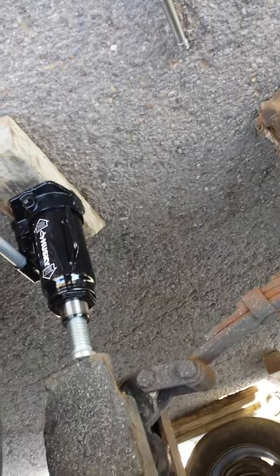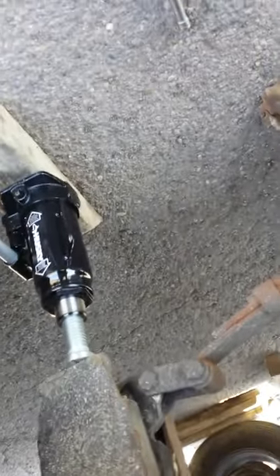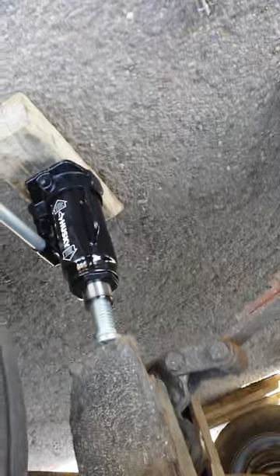These jacks are here to help. I'm actually loaded really good — my trailer weighs 12,500 pounds, so if I put all the weight on the front axle it wouldn't actually overload the axle, though I'd overload the tires. I didn't want to take a chance, so I put about half the weight on the tires — now I've probably got 5,000 pounds on the tires and the rest on the jacks. Sitting there nice and steady, no problem at all.